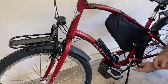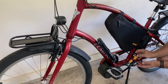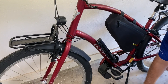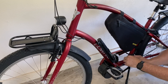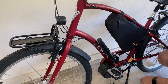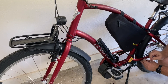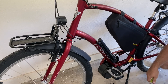In the set of wires that comes out of the motor you'll find a couple of small ones with bladed connections — that's the headlight connection. There's another that runs to the main computer connection, which I've run up by the down tube. There's still another that runs to the speed sensor mounted near the rear wheel, and then a couple more: one is a gear sensor that cuts motor power when you shift by detecting movement in the shift cable, and the other is a pair of brake sensors so that whenever you pull on the included brake levers it cuts power to the motor as well. We'll tidy things up with a few zip ties to keep wires from drooping, and then this part of the installation will be done.